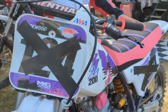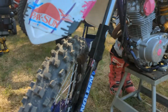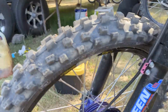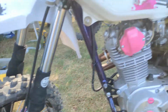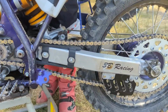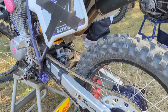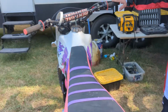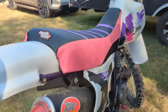We started over. It's got 1986 250X front forks, all with disc brakes modified for drum brakes. It's an aluminum swing arm off a 1984, I want to say, 250X. We've converted to a 19-inch rear wheel, XL wheels, aluminum swing arm, painted frame. We like the retro 80s looks. We do everything purple, pink, kind of fun.